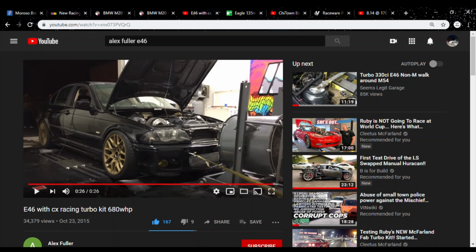This is a really responsive turbo. This sizing, it's like a 61 millimeter or so, and it's very responsive and really torquey, which is really nice. But I'd like a lot more top end power, especially for drag racing, until I get a proper engine and a proper launch down. If I can't hook, there's no point having a ton of low end power. So if I can trap high and still put a good time down while not running a ton of boost on the bottom end.